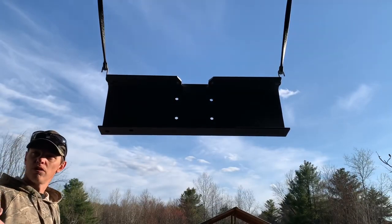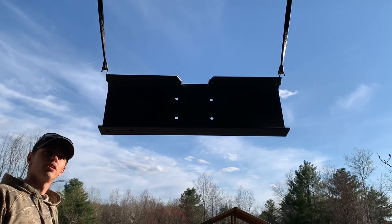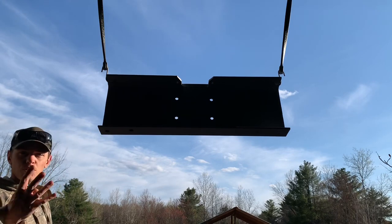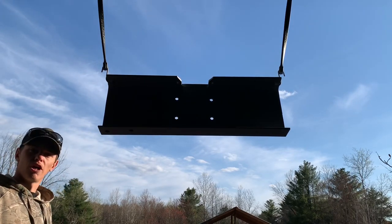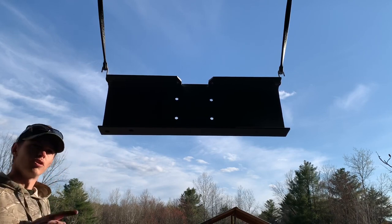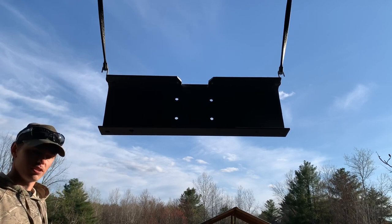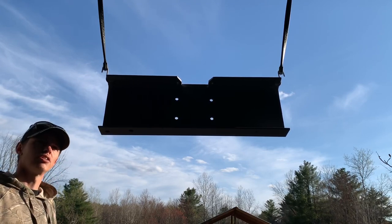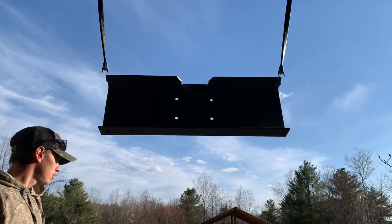Okay, I set up a downdraft fan. So there's a fan blowing air this way, and that'll evacuate some of the overspray and the fumes, and it should help dry the paint faster as well. I put one coat of primer on there, I'm gonna let that dry for 10 minutes as per the directions, and then I'll go ahead and put the bed liner on.